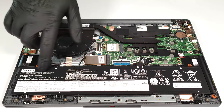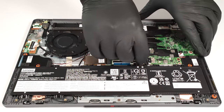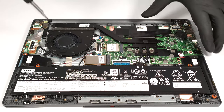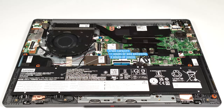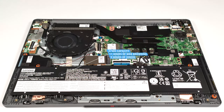The battery is a 47-watt-hour model. It's important to detach the battery connector from the mainboard. In order to take out the battery, you have to unscrew the two Phillips head screws that are fixing the battery to the base. The capacity is enough for 11 hours and 7 minutes of web browsing or 9 hours and 5 minutes of video playback.